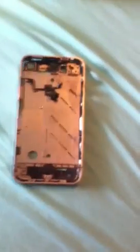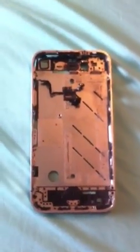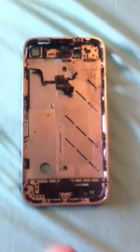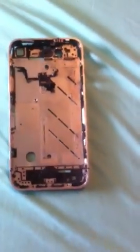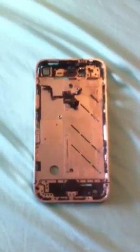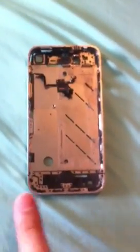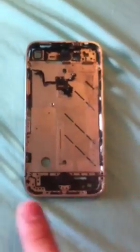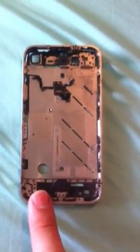For me it wasn't software, and this fix worked for me. It may not be your problem, but everything on the phone itself was working. During a video call everything was fine. During voice memos — because I replaced the speakerphone down here with that microphone — don't even bother doing that in this case, because when you're recording it's not using this one. Unless you have headphones plugged in, then it does record from the bottom, and that's what I was explaining in my first video.